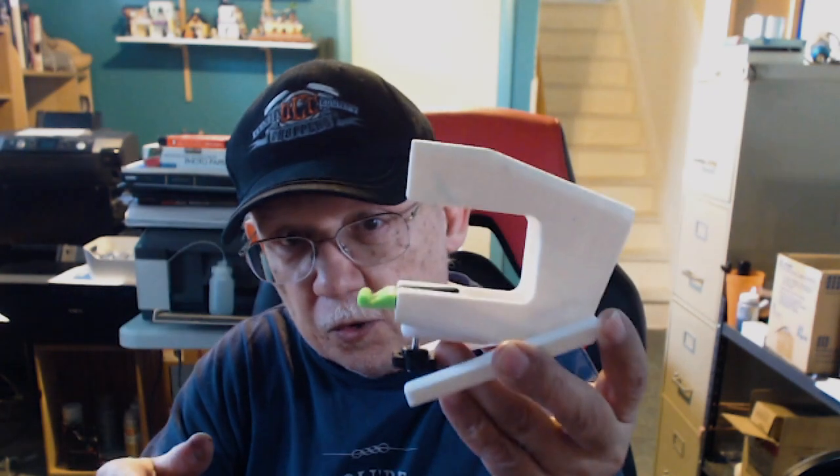You may notice that I made a couple of mistakes when I was refilling. The first time, this was my first attempt doing this with the new updated system. And basically this is it. You have a holder that will hold your cartridge in place, a cartridge clip, which you need to hold the cartridge and be able to seal the vent, because you need that in order to generate 100% vacuum. In other words, if you have any kind of leak of air, you will not be able to generate the proper amount of vacuum and the refilling simply will not occur.